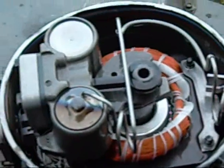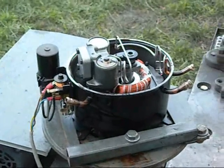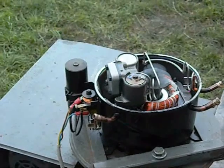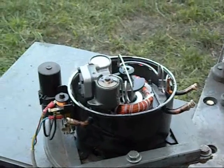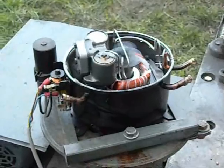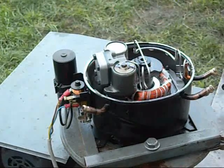This is a test of a low start torque compressor with a high starting torque relay and 60 µF start capacitor. This may or may not work — I haven't done it yet — but let's give it a shot. Hey, it does work! Doesn't seem to be doing anything bad. I guess you can use these as high start torque compressors. Bit of food for thought. Thank you.